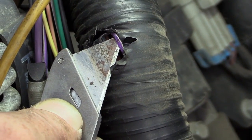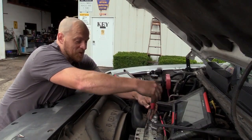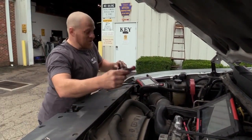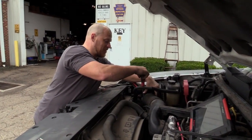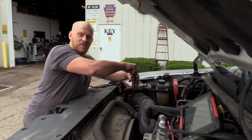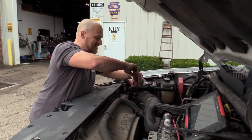Is that the reference? That's my reference circuit. So this is a good lesson, Caleb, on don't be a parts changer, don't you think? It's got a new throttle body, it's got a new cam sensor actuator. What else was going to be thrown at it new before they decided it's time to pay a diagnostic fee?